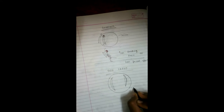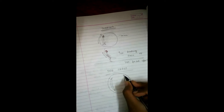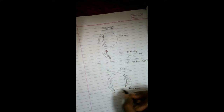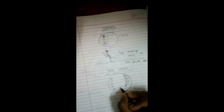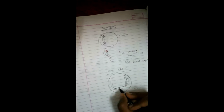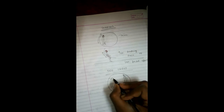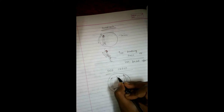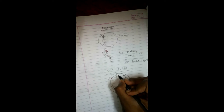In duo servo action, this is your brake drum and these are your brake shoes. Instead of making the shoes pivot, duo servo uses a floating link that is attached at one end of the shoes, through which both shoes are connected to each other. This is a floating rigid link. On one side, your wheel cylinder is there with a piston arrangement, and on the other side one anchor pin is mounted, along with return springs.